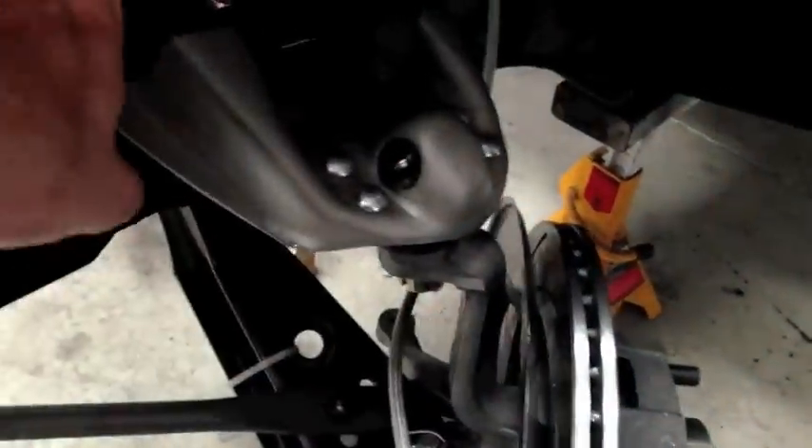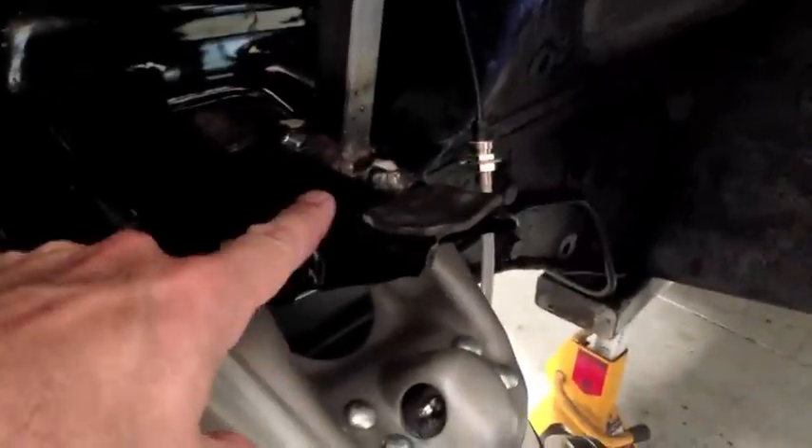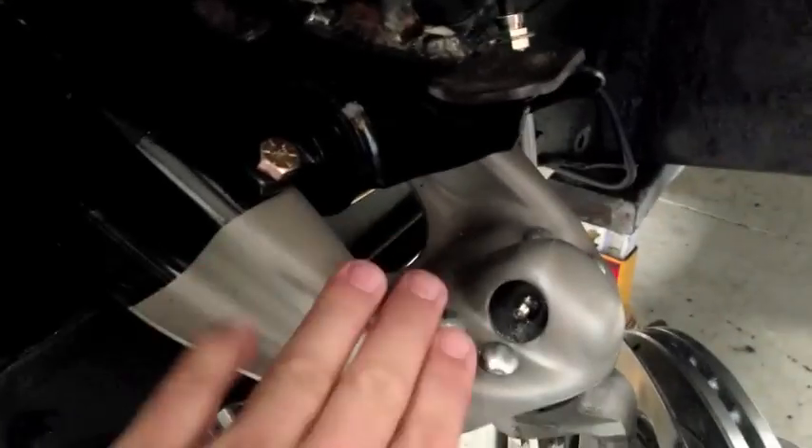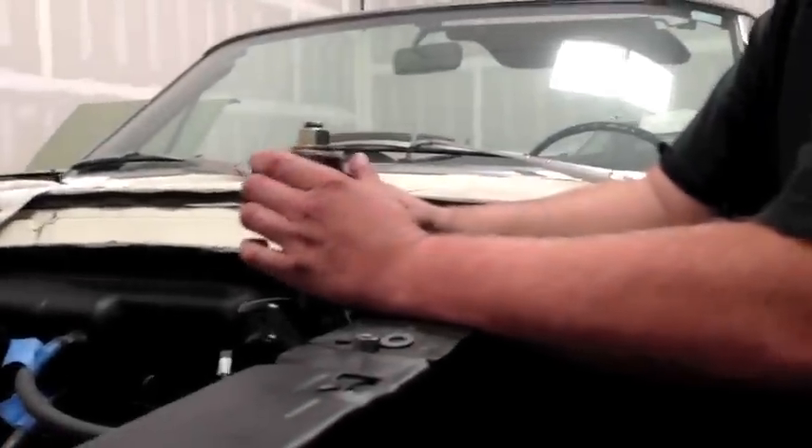So we're going to have this removed, and then we're going to have the spring down on the spring perch. We're going to crank it down to bring it up. And once it's compressed, then we put the upper control arm underneath, bolt it, and bolt it to your lower holes, which is the Shelby drop. So we created this tool especially for your project, and it's now a Mustang Medic tool for many times to come. Exciting times, and a new tool that's been custom created by Bobby Deserop.